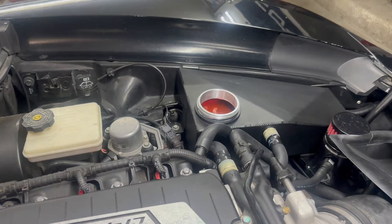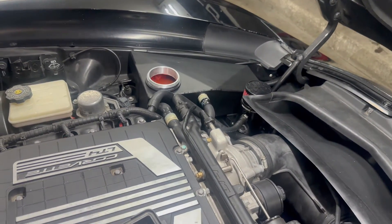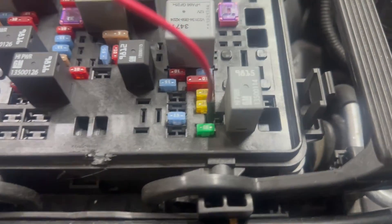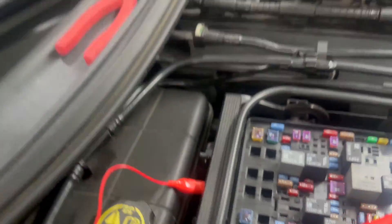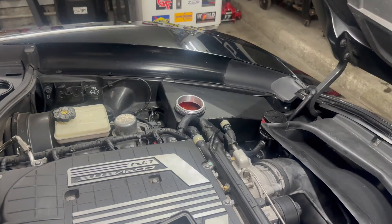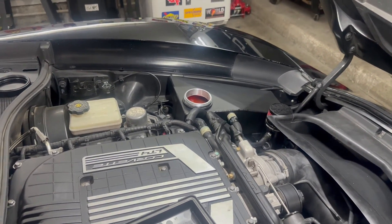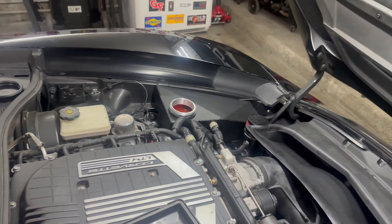You can also crack open the bleeder screw valves if needed — I found I don't really need to do that, especially with the tank in there, but it certainly helps at times. So if you need to jump the pump, that's how you do it: find that 15-amp F82 fuse, pull it, tap a wire into the left side of that fuse slot, and tap it straight to positive power. It will turn the pump on — just a little trick to make bleeding the system easier, because I know these can be a real pain. Hope this helps, good luck!